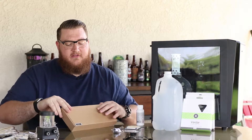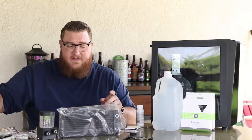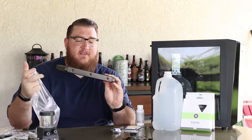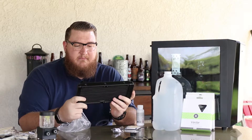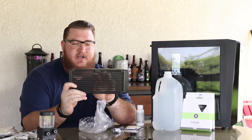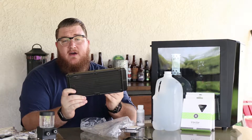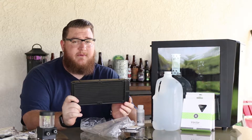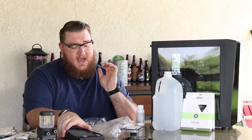The radiator is full aluminum, which means it doesn't weigh hardly anything. I've dealt with my fair share of radiators and this thing is light, like you'd find in an all-in-one system, but has much less dense fins per inch on the radiator itself. So the airflow is going to move through here very easily without having to have noisy or super high pressure fans. That'll actually be really nice in the system to keep things quiet and cool.